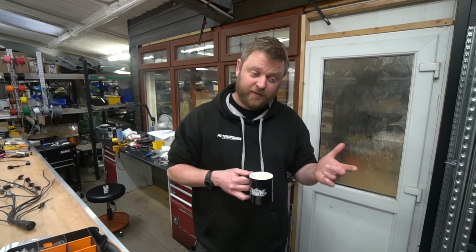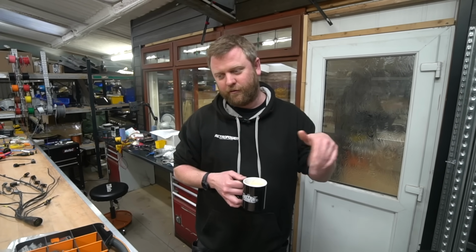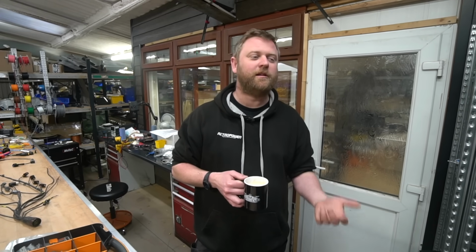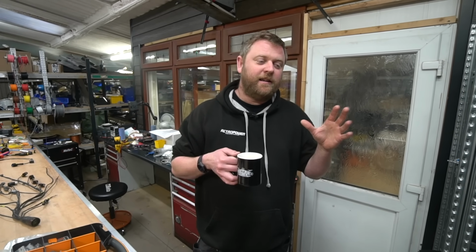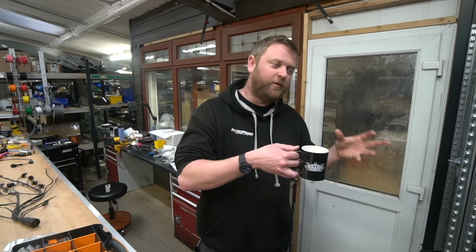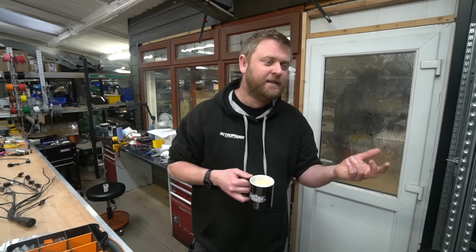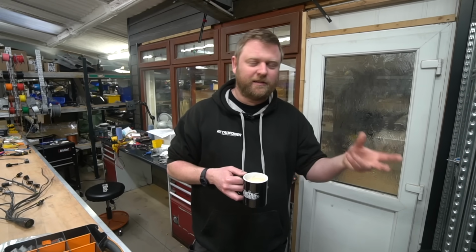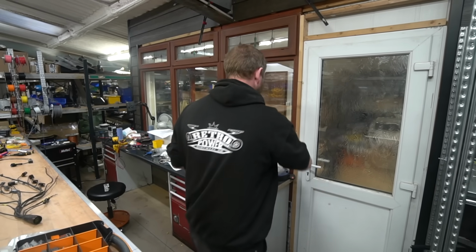And we've got the transmission here, which Dave also sourced for us. So the idea is, once we've got the Quattro jigged in there and we've gone through all the rust repair stuff, the start of dry build will be get the engine and box mated up, get them in the car, get the intake manifold 3D print on there, get the turbo positioned where we want it, and we'll get probably a billet collector from Elmer Racing. Then we can fill in the blanks, make the exhaust manifold, and then plan out the rest of the engine bay layout from there. So that's something that's going on in the background.